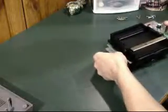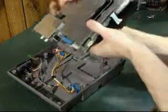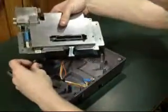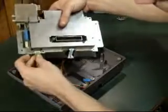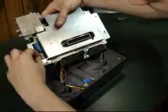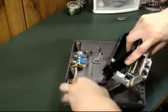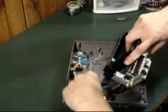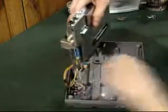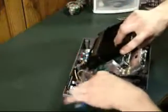Now that we've got that done, we're going to pull out our bottom again and flip this over, and we're going to reattach all of our controller ports and everything. Remember that your short one on the right goes to the bottom, your long one goes up on the top, and your blue one attaches to the blue. I like to tuck the blue one in behind and underneath these other two controller ports so that it stays out of the way.